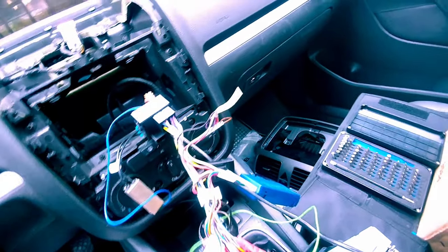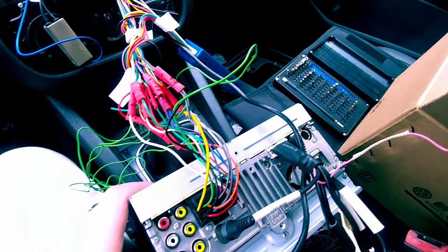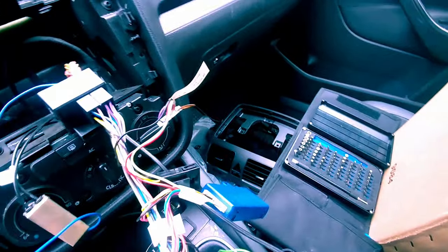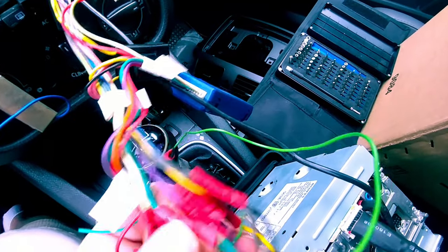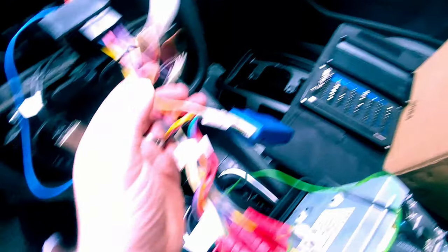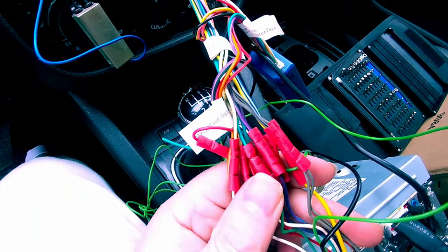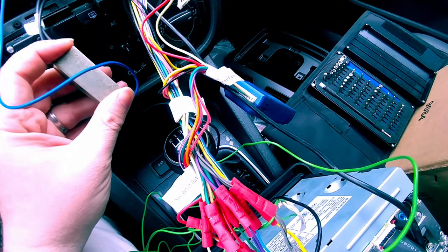26-year-old me versus 36-year-old me — I also took out my aftermarket 2-DIN player because when I'm driving and hit a bump it sometimes shuts itself off. I wanted to redo a lot of things I did in my 20s versus what I know now. I used standard crimping-style connectors for all the wires; some I over-crimped with exposed metal and wires. What I'd like to do is redo all this, zip tie it neatly, and actually solder the wires together versus just crimping them — it should be a better mechanical connection.